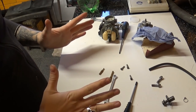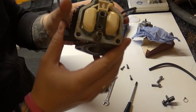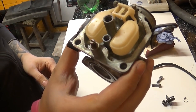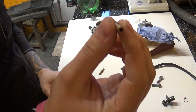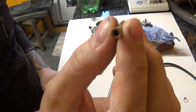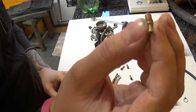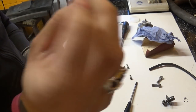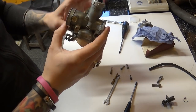Another thing you guys suggested is to take apart and clean the old carb. It's been cleaned before and I've just double-checked it — no gunk, no rust, no residue inside, and the jets are looking nice and clean. I can blow through them, so it all seems to be okay. There's no diaphragm to worry about in this one.